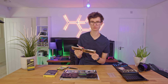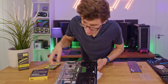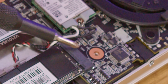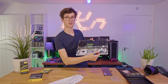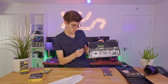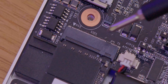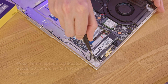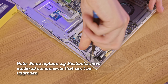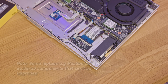Having a closer look at this laptop, it does actually say on the motherboard in very small text: SSD2. So I think it would be safe to assume that this is our additional storage drive, and then this would be our boot drive because it's labelled SSD1. I would always start with SSD2 before you remove the first one, unless you actively want to upgrade your boot drive. It is incredibly easy to swap out — you just grab your cross-head screwdriver, unscrew the screw, and take out the old one.